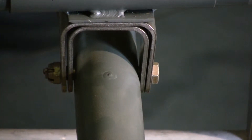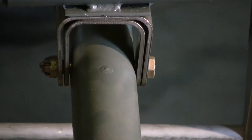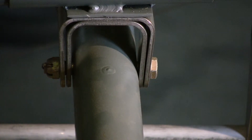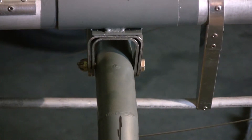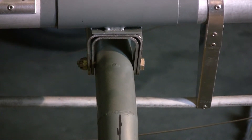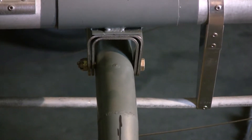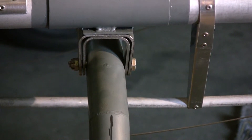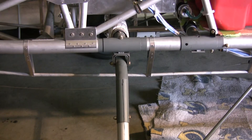However, you do not want to make the mistake of using the wrong or too-short bolts. It's an AN5 bolt in there and as you can see I have a castellated nut on it. But it was a short bolt, and because it was short, as I tightened that down to set the screw and get the hole aligned so I could put a cotter pin in, you can see how it's pulled that bracket in and bent it inward. This places an undue amount of stress on that bracket, which you do not want to happen on your aircraft.